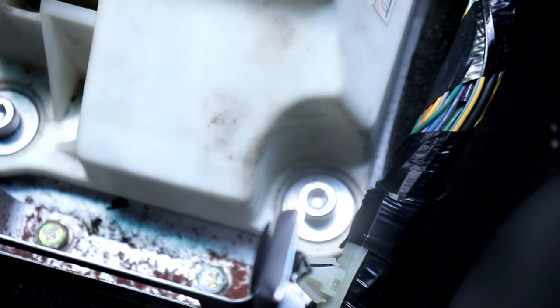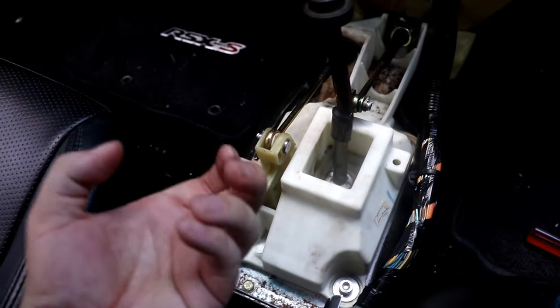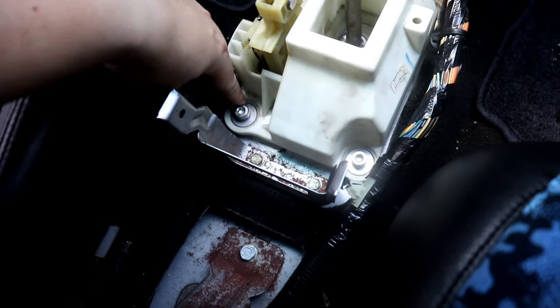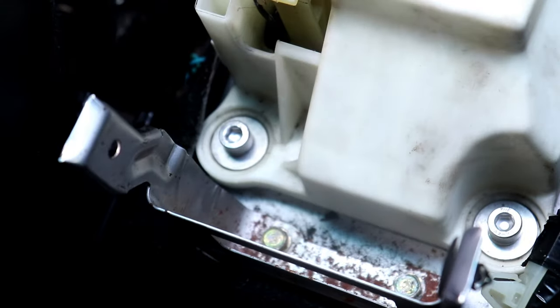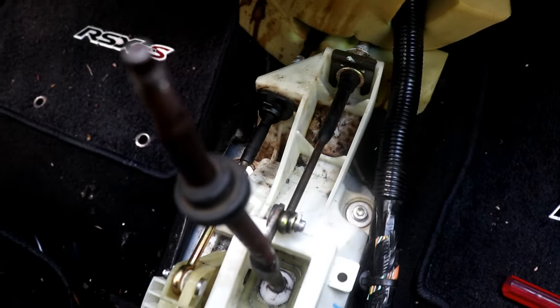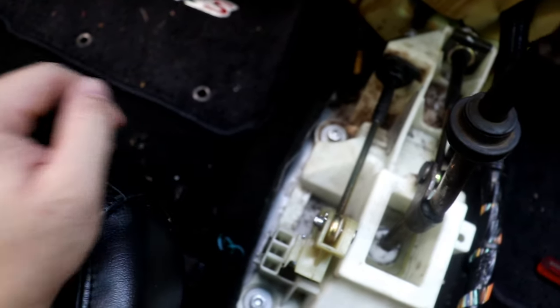This segment was recorded the morning after I installed the shifter base bushings. Going through the footage, I realized the bushings didn't seem right. After a little Googling, I was pretty sure I put them on upside down - so here I am the next morning fixing that. The washers should be on top. The base bushings come in under the shifter, then the washer goes through the inlet, and the mounting bolts with lock washers go on top. I feel really dumb, but it's corrected now. The only thing that would make me mad is if I was actually right the first time and have to switch it back - but I'm pretty sure this is right. That's how they're supposed to go on.